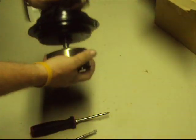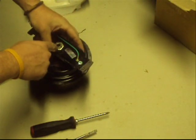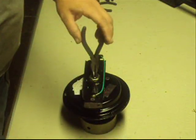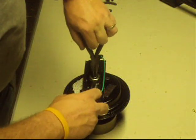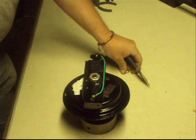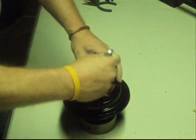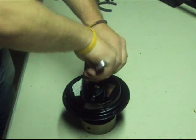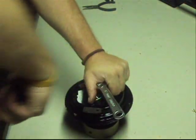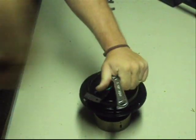A good way to get this side: try to turn and see which one turns first, just like with wrenches. This one loosened up. I'll show you how to get that snap ring right here — you get a pair of needle nose pliers, spread those out and lift up on one of these tabs. We're not trying to save this. Got it off. You can take an adjustable wrench, which I already pre-measured on it — slide it up to where it's pretty snug, take a larger wrench, and put some impact on it. It will slowly move.